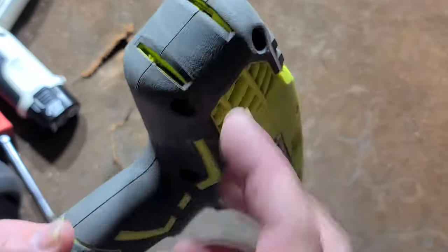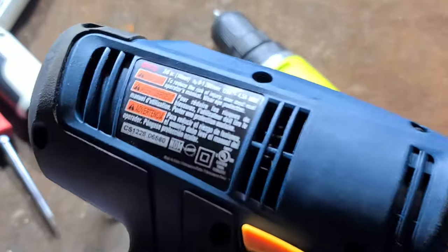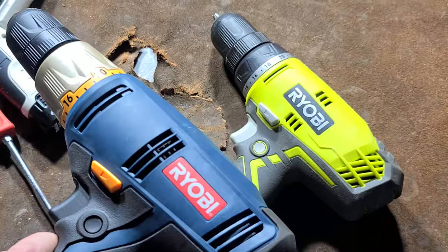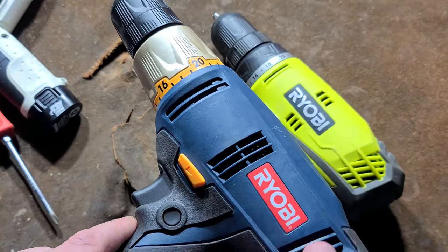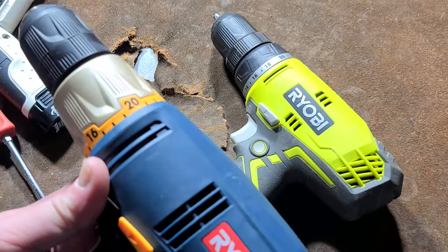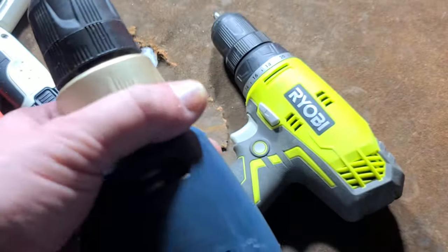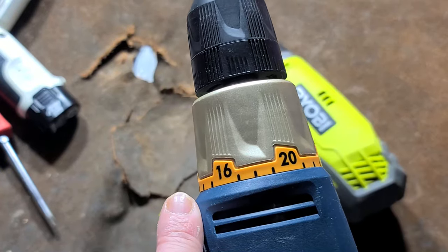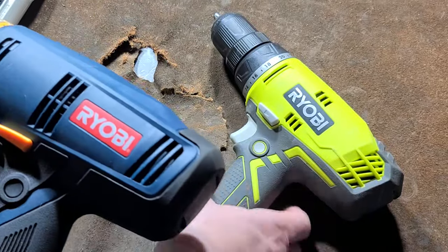Pretty well balanced, plenty of over-molding, nine screws to hold it together. You may remember I reviewed the D47C — so it's exactly two generations, probably 20 years they were making this thing. This had a die-cast aluminum gearbox. Same thing: cordless drill front end, so the motor runs right down through the centerline of the chuck, which is kind of interesting. You have a more rounded drill because the gears are in a circular-type gearbox — planetary versus spur gears where you have an input that comes in, an offset gear to the side, then another connection to the spindle. Everything's in line.